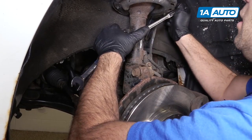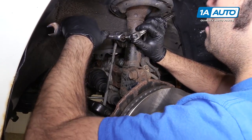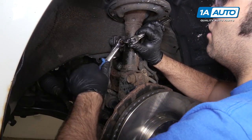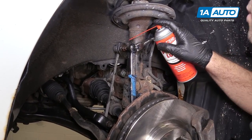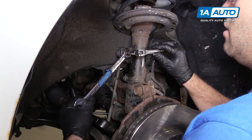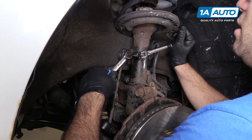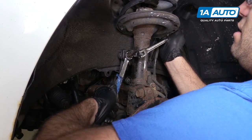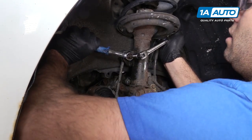Sometimes you have to brace that against the strut. It's moving — it's really tight though. I'm going to spray some more rust penetrant. These are typically self-locking nuts, so they're not perfectly round — they're kind of oblong — and that can make removing them difficult. Also the rust gets gummed up in the threads, so I'm trying to spin this on and off to try to work the rust penetrant into the threads.